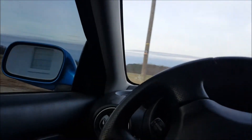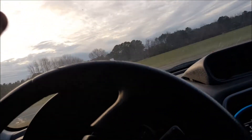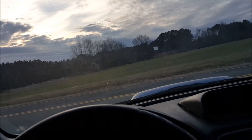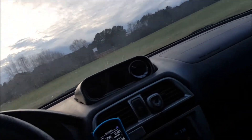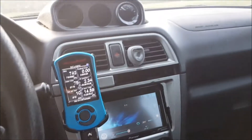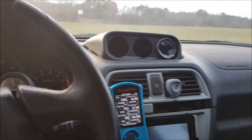You'll want to start out at around 2,500 to 3,000 RPM, then lay into it and rev it all the way out to wherever you want your theoretical power drop-off — say 3,000 to 6,000, 6,500, or even 7,000. Then stop logging. After you've stopped you can do a couple of runs so you can compare them. You take the Accessport, unplug it, take it inside, and I'll show you how to get the data log off it and put it into Virtual Dyno.